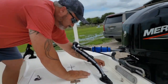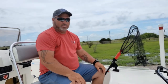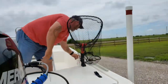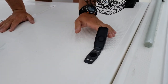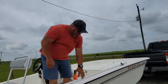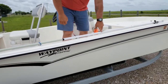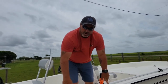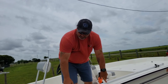You've got a little access panel right here — you can pull that out and access your aerators or clear anything stopping up the drain, like grass or trash from casting. There's also another spot for your plug-in light, same as I showed you in the front — just plug in and it's plug-and-play. This pole I got from Granger — it's 10 feet long with a tensile breaking strength of 100,000 pounds, so there's not a boat out there I know of that'll break this rod. It's the same exact rod they use in power poles, only bigger — it's one inch, most power poles are half to five-eighths inch. This works great — it's a poor man's power pole.